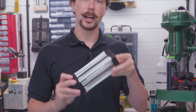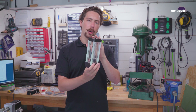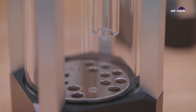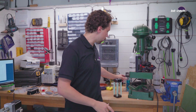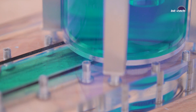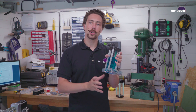So this is a heat killer tube reservoir — it has a 60mm borosilicate glass tube on the inside which means it has no threads on it. The reservoirs have aluminium struts inside which are threaded on the inside. On either end at the top and bottom are big fat O-rings, and these compress using M4 screws that thread into the bars themselves, giving you a nice tight seal along the edge of the glass without using any threads. Because it's a simple design I can quite easily incorporate it into a distribution plate. I've got a test piece I made as a proof of concept and as you can see it does hold water — so I'm basically going to be doing this, machining a plate along the bottom with channels that come in and out and using the existing compression method and O-rings to ensure the tubes all line up.